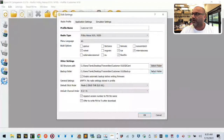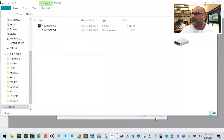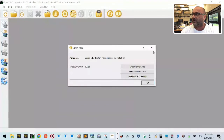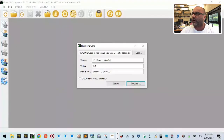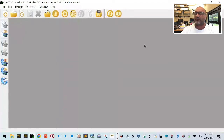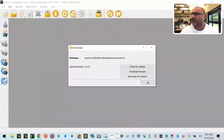If you flash your firmware, you select where you want to download it — it's opened up already. Click Download Firmware, I've already downloaded mine. Click Write Firmware to Radio, locate the firmware — I've got mine saved in a custom X10 SD card folder. This is the firmware I just downloaded and it has i-access, which means internal access module. I named it that way to keep track of different firmware versions.